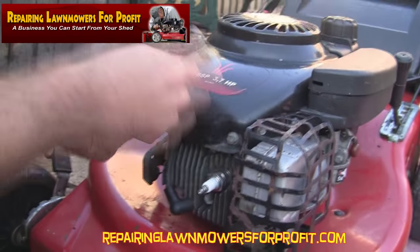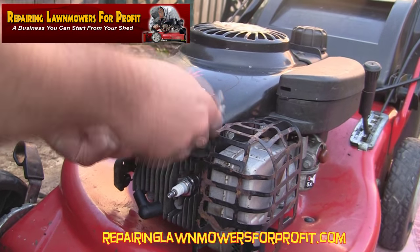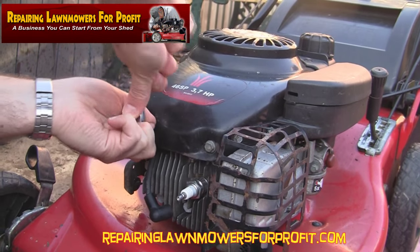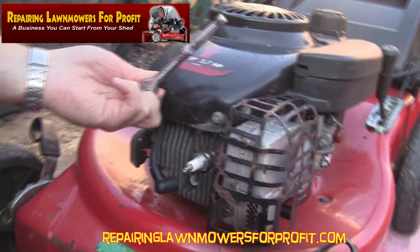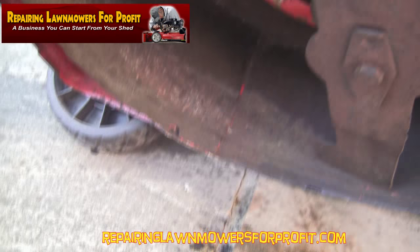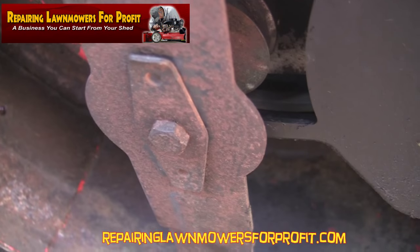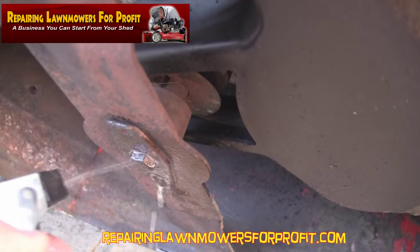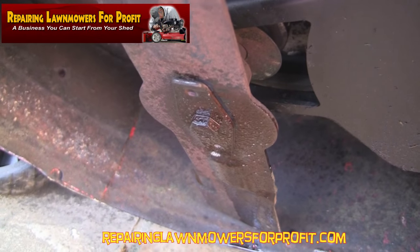Right, so we'll put it on the bolt. Let's just tighten this up. I'm not sure why that bolt's missing — I wonder if it's never been there or someone serviced it and didn't do it properly. Let's just tighten that in there. So with the spark plug ignition lead removed, I've stopped oil pouring everywhere. I've jet-washed underneath — what I always do. Just wire brush around this bolt here; if it isn't clean you put a socket on and you won't get it off. Always get some WD-40 on it as well. Leave it a few minutes and we'll try and release this blade.